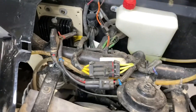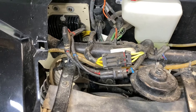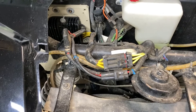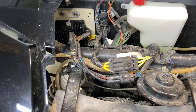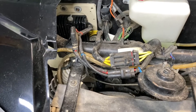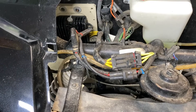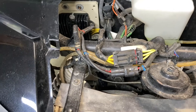Next I checked the voltages on all three legs of the stator. There's a procedure in the service manual that tells you how to do that — it's 20 volts on the legs of the stator — and that was fine. It was right on the money, so I was good there.